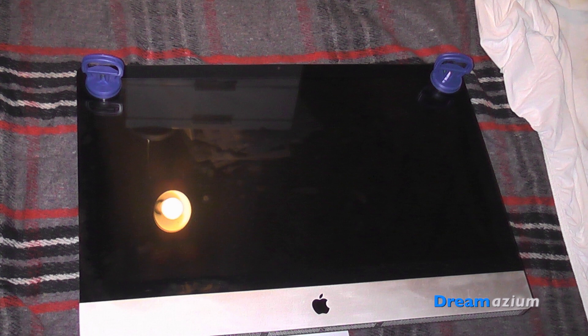On the whole, it was a lot easier than I thought it was going to be. Now all I have to do is format my hard disk and restore my machine from a Time Machine backup. The easiest part was taking out the hard drive, removing the little grey frame, swapping the mounting bits over to the new hard drive, and then putting it back in. That was very easy.